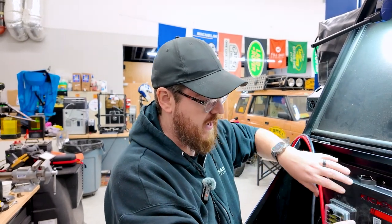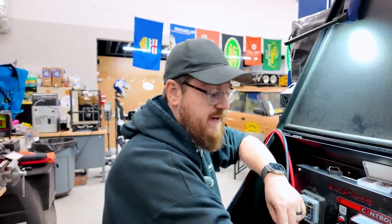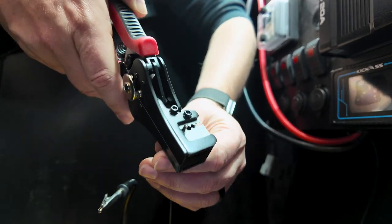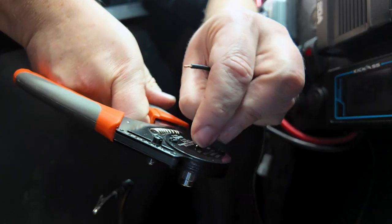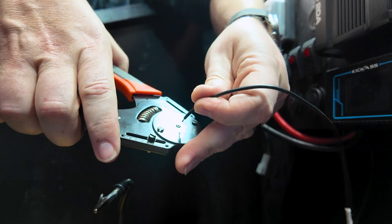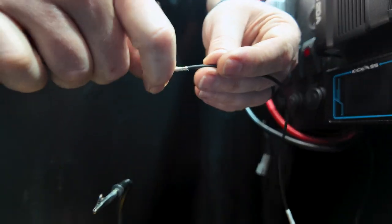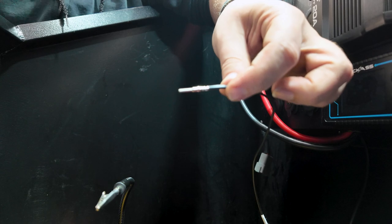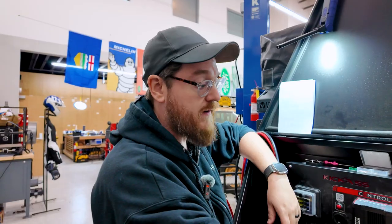The bulk of the big work is done. Now we're going to pin out the interconnect between the trailer and the fuse box. They use these tiny little pins — super high-amperage pins. First, I strip just a tiny bit of wire, then take one of these tiny pins, insert it down inside the tool, take the wire and insert it inside the pin inside the tool, close the tool over, and now you've got a very strong mechanical connection rated for 20 amps.